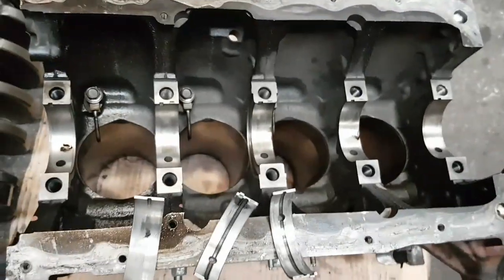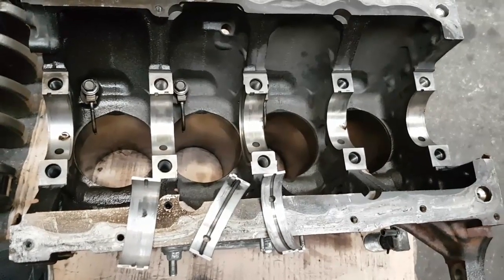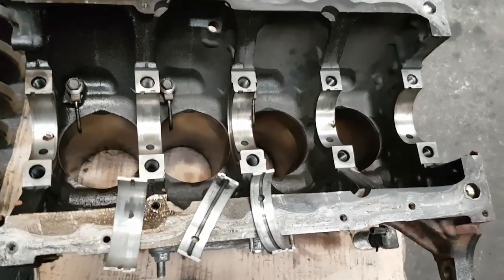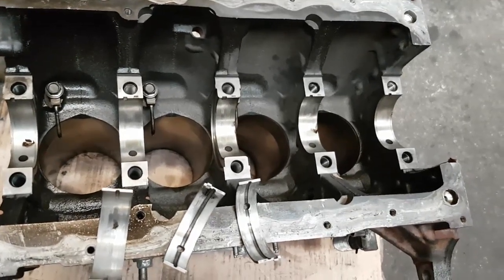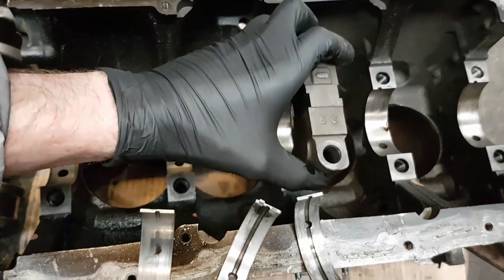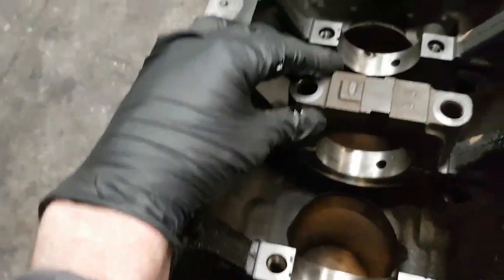You may think that's not very much, but actually it is — it's enough for the crankshaft not to run true. If the crankshaft runs slightly off, it'll start wearing that oil pump gear. Eventually, if the crankshaft is not running true and straight, it can either seize or just start running off true and wearing away the main bearing shells and the engine block on the bearing caps — and that is exactly what it has done.